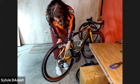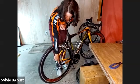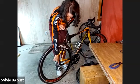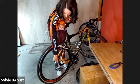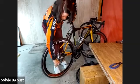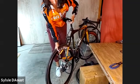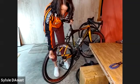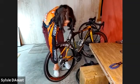Okay, now the next thing is, so 1, 2, 3. Okay, let's back up. Step 1, between the chain. Step 2, you drop it on the last gear, the little pulley wheel on the last gear. Step 3, you take your thumb and you push it, and I'll show you what I'm talking about in a second. You push it down and it's going to fall into place.